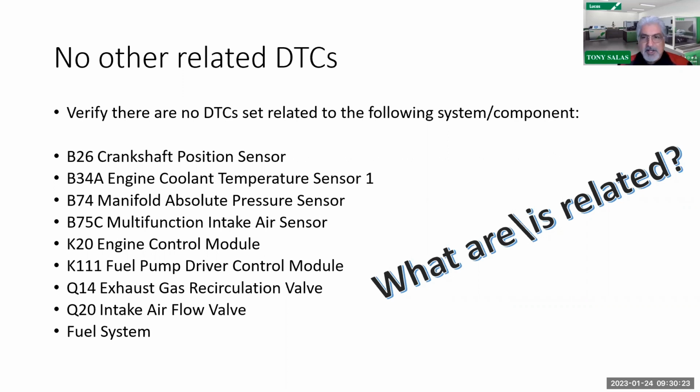And if the exhaust is restricted due to soot accumulation in the DPF, will that also cause backup pressures, or shall we say, back pressures up the intake of the engine itself? So there have been guys that I've told, the next step you may want to consider if the engine runs fine is, what is the differential pressure on the DPF? And maybe we may need to run a regeneration to clear the DPF.